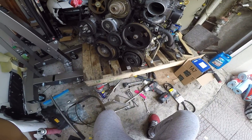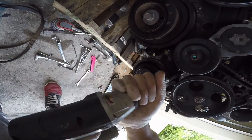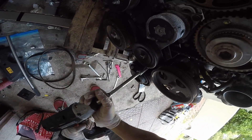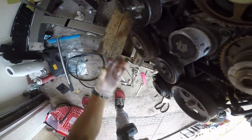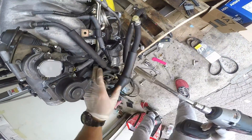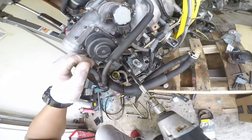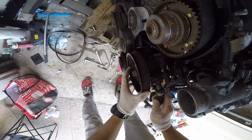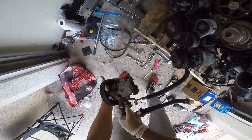To pull the compressor out, we need to release the power steering pump. Same thing — there's one bolt here and another bolt here, so it's also a 14 millimeter. There's the bracket that holds the pump in place. Remove bolt one, then number two, and from here you remove the power steering pump — just like that, easy.